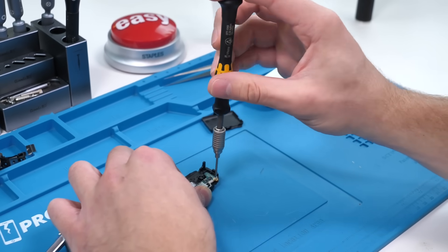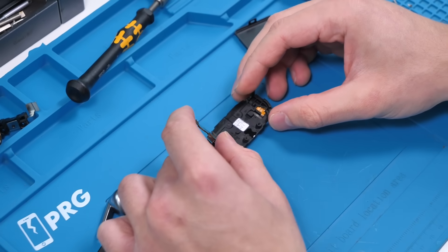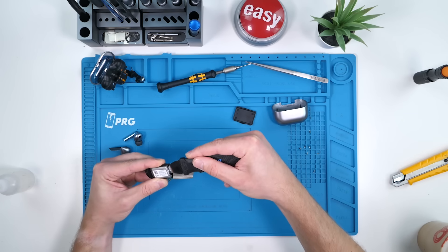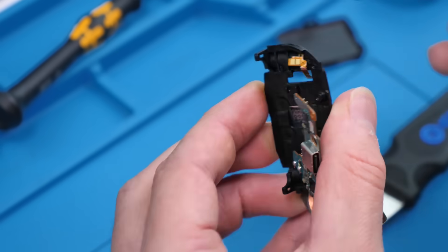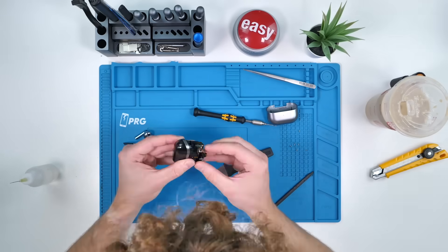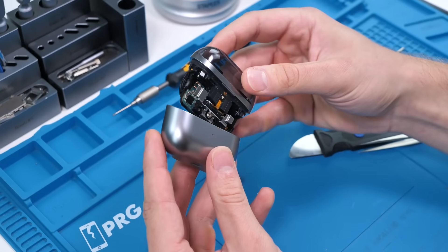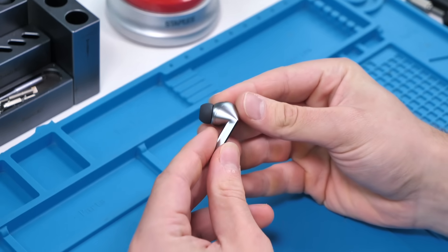We still need to disconnect the battery — we haven't done that yet. We have that unscrewed. And whoa — okay, it's as easy as that. You can just remove the board. There's no connector here, so you can literally take your Jimmy tool, pry under the battery, pop it out, then take a spudger and just pry over here. And just like that, we have the battery removed. Compared to the AirPods, these are extremely repairable, minus the USB-C port. We managed to tear them down and put them back together with absolutely no damage.